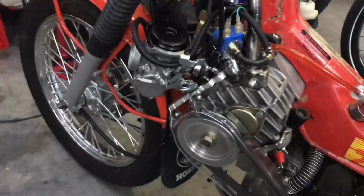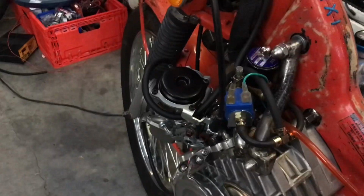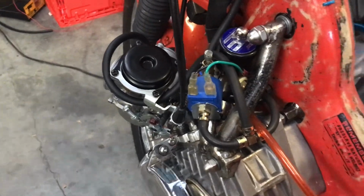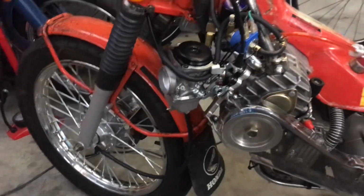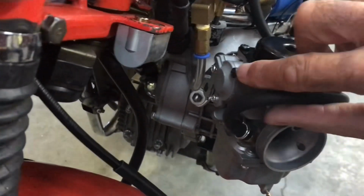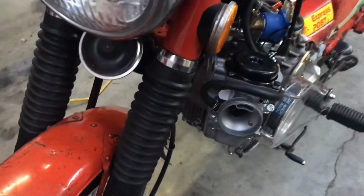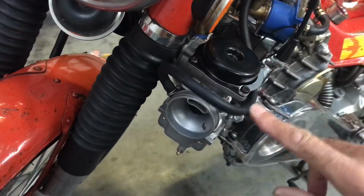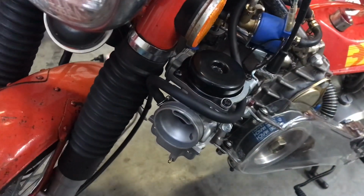It's hooked up, but it's not running well. It says to me, way too lean. So I've got to pull it off and richen it up somehow, but that was the first run. Here is the clearance issue. You remember I had that one screw, that's all flat one there? Well, straight ahead it's okay, but as soon as I turn the steering just about at full lock, I have to run this cable up over the carby. So I run it that way, it just fouls it. See how that's touching there, moving the carby? See that? You can hear it.